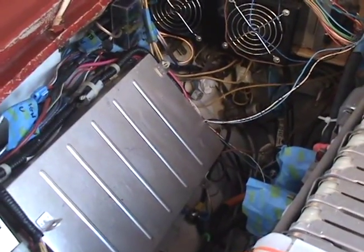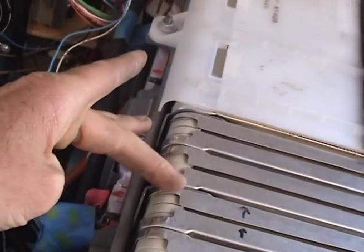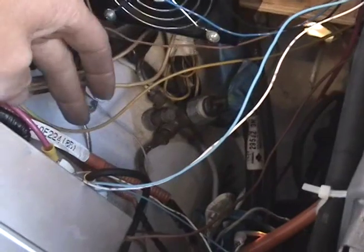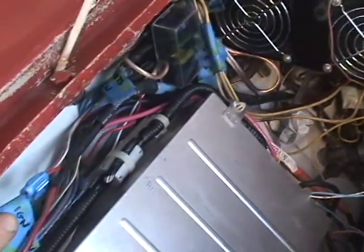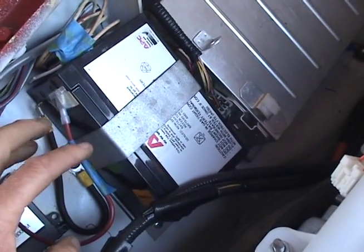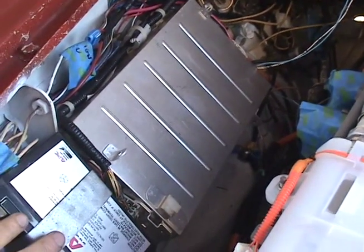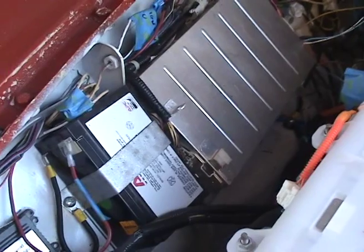This here is a DC-to-DC converter. It requires 100 volts, so it's wired directly between the front and back packs. The output is obviously 12 volts, which trundles around here and charges this fairly small lead-acid pack that runs the lights, horn, and ignition. This is only operational when the car is in drive mode, which is just fine — you don't really need a huge battery because we have no starter motor to start.